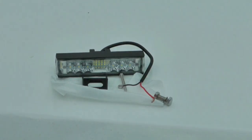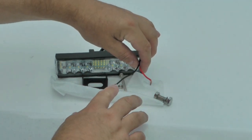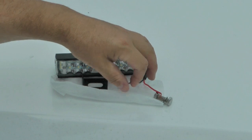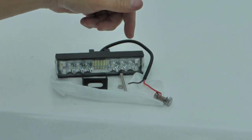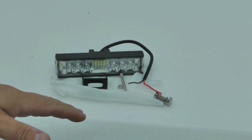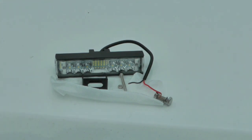For wiring, I'm going to solder a black and a red wire approximately the length of the gap between the two lights, solder these together, and then on the one from the passenger side, solder wires that will run to basically underneath the glove box area where all the power wires are. I've already pre-wired in the switch and we'll just add a relay to click these on and off. I do have a video if you're interested in having your fog lights and grill lights automatically click on when you turn on the high beams — I'll post a link to that video as well.